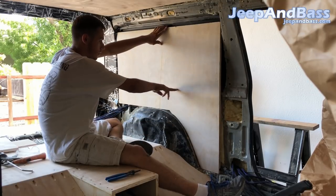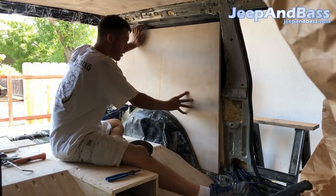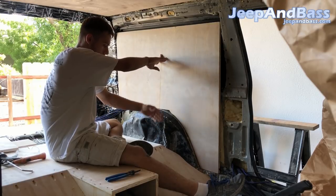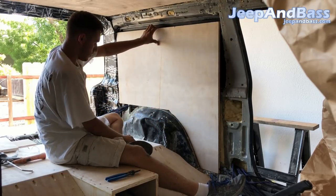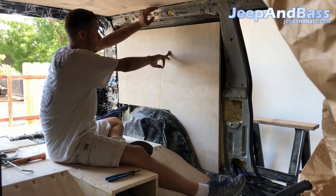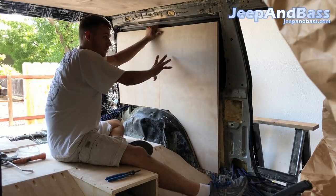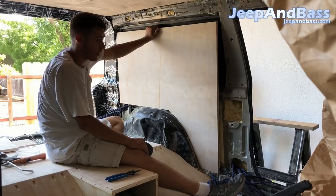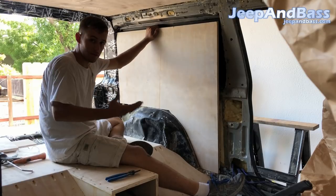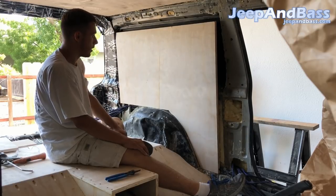Whenever I install parts into the car I'll silicone whatever metal is touching and then screw it down where I can. On this one I have a line right here where I can attach it — you can see the bracing. Once this is in I can build out from it, put a roof on it, make 45s that come into it, and it'll patch itself together. First things first, I need to copy this piece for the other side so I don't waste time making a duplicate. Turns out this one fits really well over there too, so I got lucky — sometimes cars aren't perfectly symmetrical.